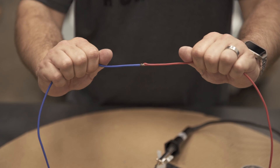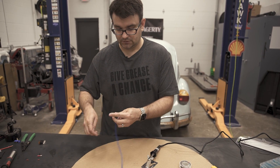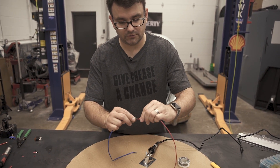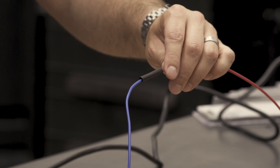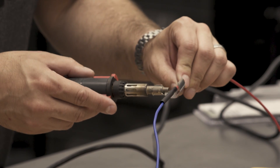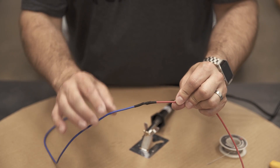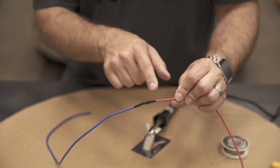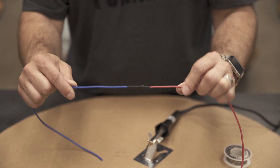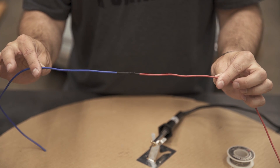You can see they're really held together with this solder. To finish it off, once this is cooled down a little bit, we'll put our shrink tube on and make sure to completely cover the exposed wire. We'll go ahead and use our nice little shrink tube tool. As you can see with our connector now, the bare wire is completely covered by our shrink tube. It has been soldered together and this is a very strong connection, both electrically and physically — you can't really pull them apart. This is the best scenario in my opinion for connecting two wires together.